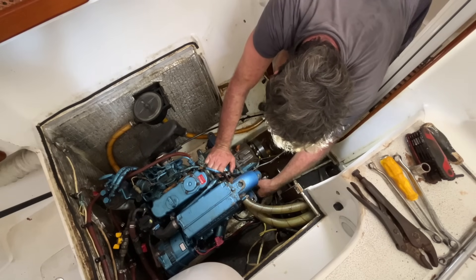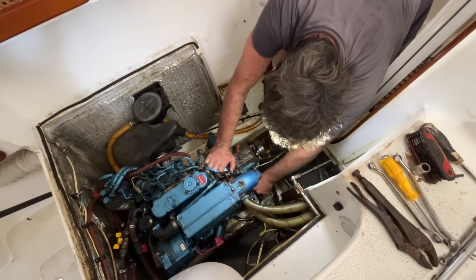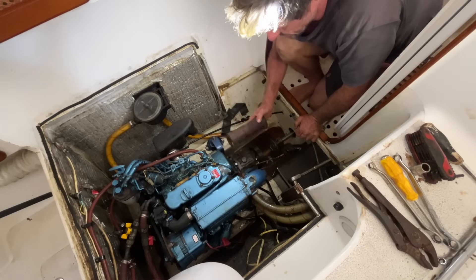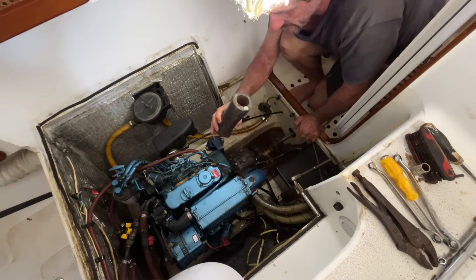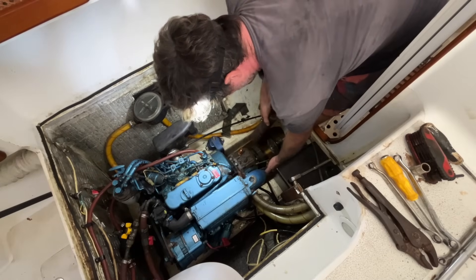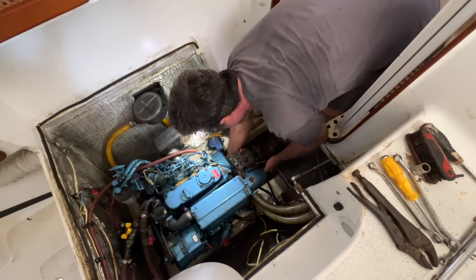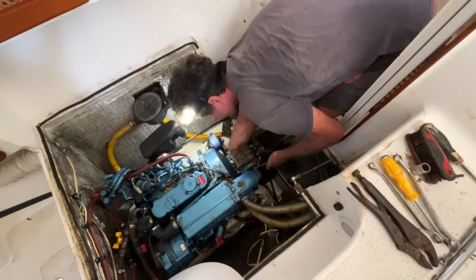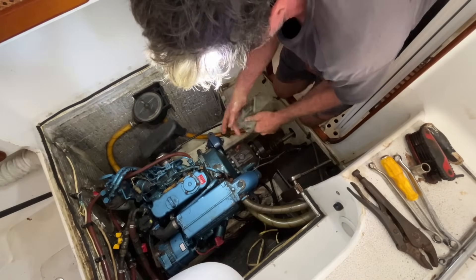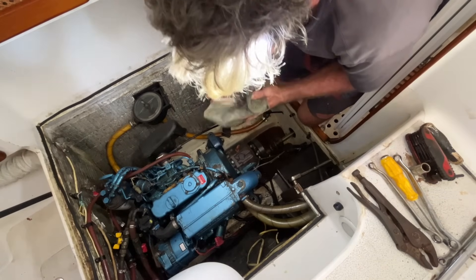Because I've done this a couple of times in the last few weeks, these bolts are not rusted or corroded - they're all quite easy to undo. Pretty easy. Because I'm taking the engine off the engine mounts, I've got to support the rest of the engine. This piece of bamboo has proved to be the right size - we put that under here, under the sump, and lift this up. There we go.